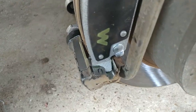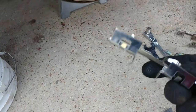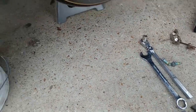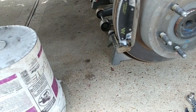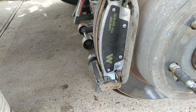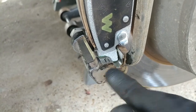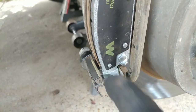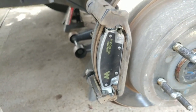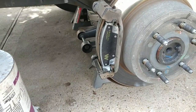I did decide to use the new little metal brackets — real simple to install, takes probably 10 seconds. Here are the old ones. Since you're already doing new brakes, might as well do those. They just go under there, nothing to them. I greased up the bottoms wherever they touch the caliper bracket and greased up the top for the pads when they slide back and forth. I'll do the other side — it'll be exactly the same thing, then I'll move up to the front.